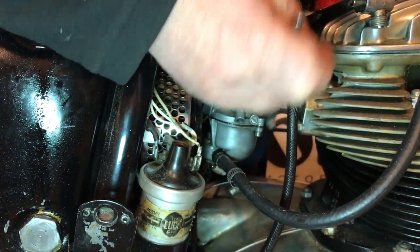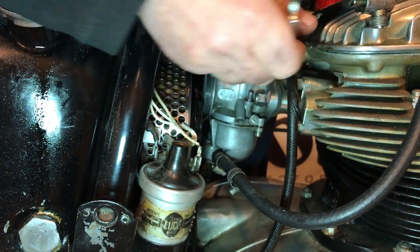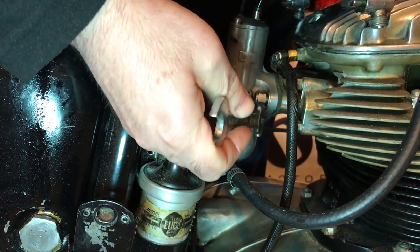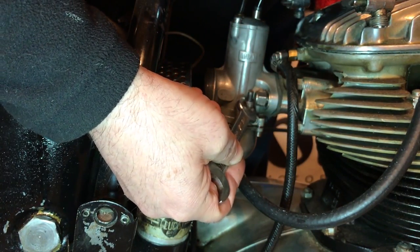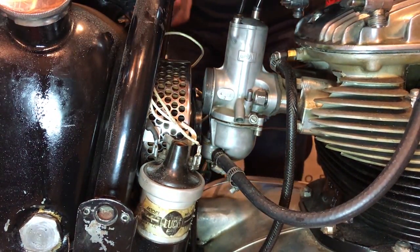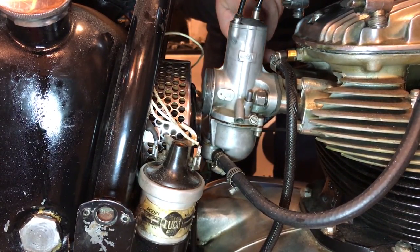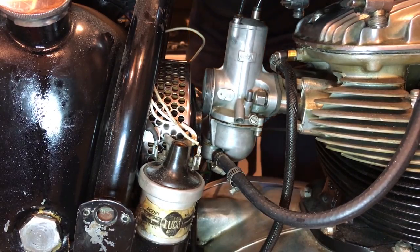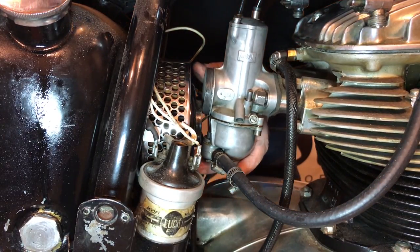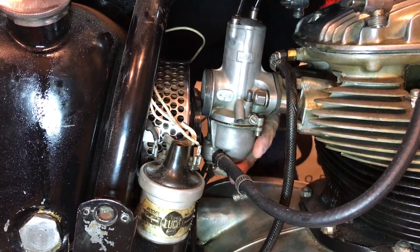Okay, 5/16 Whitworth. These nuts. This nut may not come all the way off because of the tickle. So what I'll do is I'll just edge it off a little bit. Yeah, I can feel it is kind of rubbing on that chamfer there. So just back it off a little bit on both sides. Start working it back and undoing the nut at the same time. Yeah, it's hit on this side as well. So just kind of, there we go. There's a lot of gas.